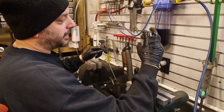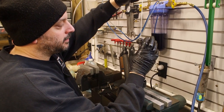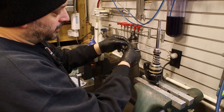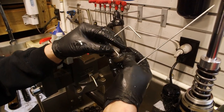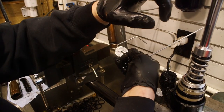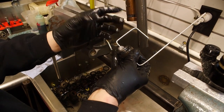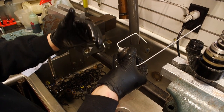You want to be careful taking it off as an assembly - however you're taking it off, keep it together so that you don't screw up any of the orientation of the shims. I'm also looking for any damage and discoloration. Once I get everything apart and laid out, I'm looking for any distortion in any of the shims right where it goes on the arbor. If a shim isn't sitting perfectly flat on that piston, it's letting oil pass by unmetered. You want that shim nice and flat - any problem in the shim stack will affect how the shock is dampening.